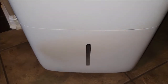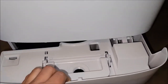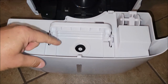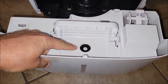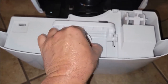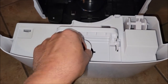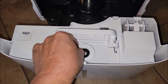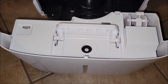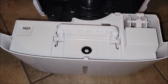If you want to use the pump on the back, when you open up this tank — this is the water tank where water would get collected in normal operation — there is an adapter right here, and it shows that in the manual. This adapter is what has to be used with the hose they provided for the pump. To pump water straight out of the unit out the back, there is what looks like a hose adapter back there, but it's specifically meant to be used with this adapter and the hose they provided.